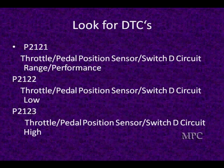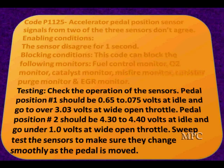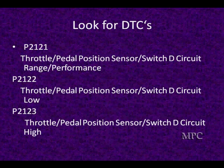Remember we had a range that went from 0.5 to 4.79? When you get a code like P2121, it says this particular sensor went outside of that normal range — it was down to 0.2 volts or up at 4.9 volts in that example. But you have to know what the range is for the code you're working on. That's why you need to go back and find something like this so you know what voltages it is. Its range was wrong, or it didn't perform properly.